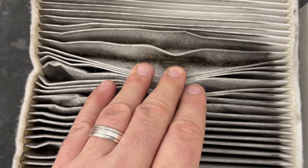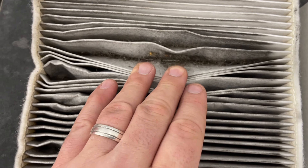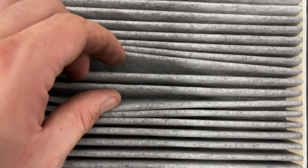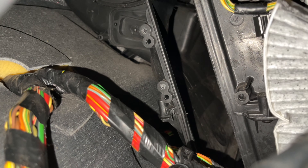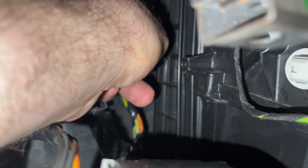You can see side by side that this one probably hasn't been changed for quite a while — you can see all the built-up grime in the fins of the filter. With the new one I had to end up folding the filter slightly to get it into position so that it would slide in. Once you've got it lined up it then goes in no problem. Then replace the housing cover, put in the securing bolt. The easiest way to reinstall the bracket is by feeding it in from the left side and round into position.